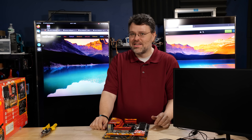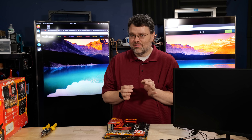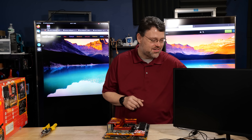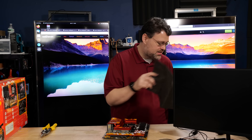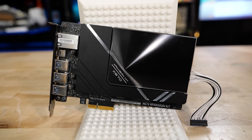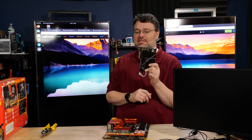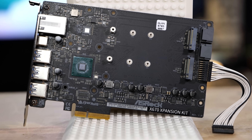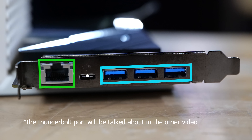The Live Mixer has a little bit of a secret — my secrets are leaking out with the motherboard secrets. PCIe over stuff. The old hotness was TCP/IP over Carrier Pigeon; the new hotness is PCIe over Carrier Pigeon. This is the X670 expansion kit from ASRock, and this is one seriously cool piece of kit. This PCIe X4 card plugs into a J2 connector on the motherboard via ribbon cable. When you break it down, there's two M.2, two SATA ports, three USB 10 gigabit, and 10 gigabit Ethernet — all on one monstrous PCIe card.